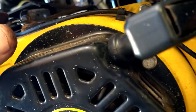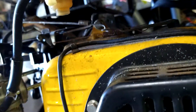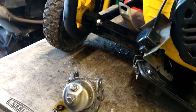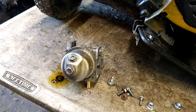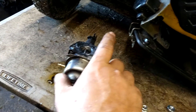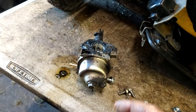There's supposed to be a spring on there too — it's broken. There's a spring here that is broken; it goes all the way to here as well. That keeps it from surging. I'll be putting a new one on. Flip the carb upside down — you can see the bad gas running out of there. It's not supposed to be yellow. Take that bowl bolt off with a 10mm, but before you do that, give it a good rinse to make sure there's no dirt that will work its way into the system.